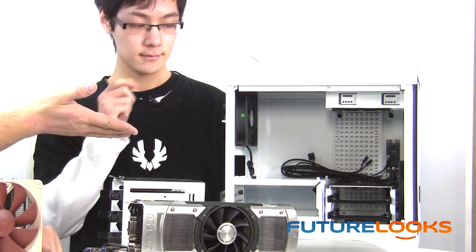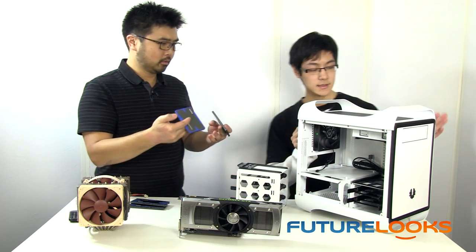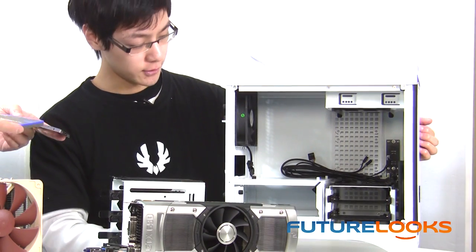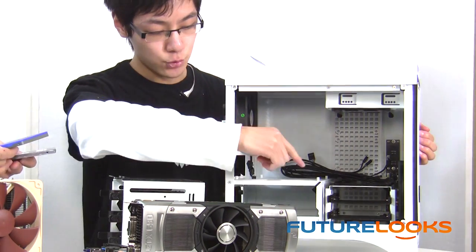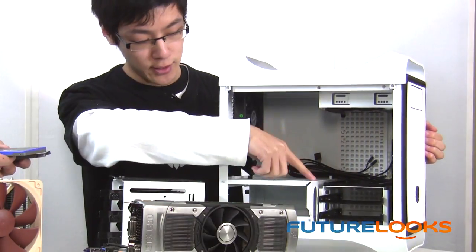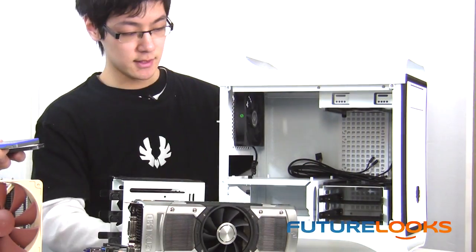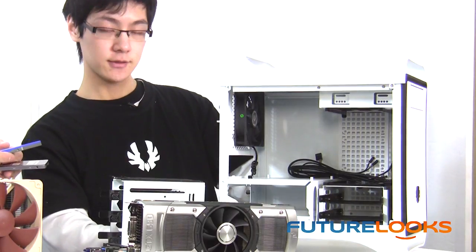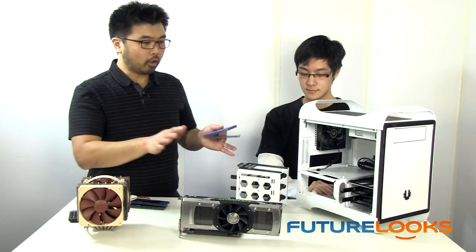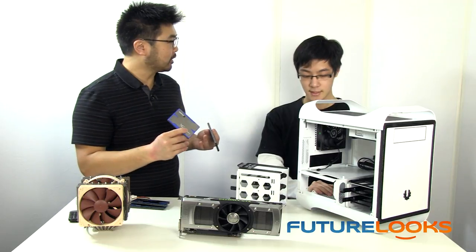You've got space for 3.5-inch drives, but do you still have room for SSDs? On this side panel near the rear where the USB ports are, there are actually two extra SSD mounts. There's one on the PSU wall. If you remove this hard drive cage as well, you get an additional one. And on the floor there's another SSD mount. So essentially, if you remove every single hard drive cage, you can place five SSDs in here without a hitch. So if you just ditch all support for 3.5-inch devices, you can run a full gamut of SSDs inside.